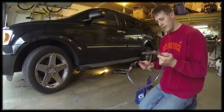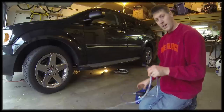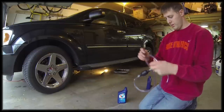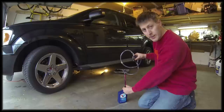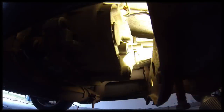To do this fluid transfer, I'm going to use this fluid transfer pump. There should be an arrow indicator showing which way the fluid should flow. We'll have a full can of new ATF fluid, use the fluid pump to actuate it, and it should bring fluid up through the hose — that's how we get the fluid into the transfer case. You're going to need your drip pan underneath the transfer case, because we're going to pump fluid in until it starts running out the top — that's how you know you have enough fluid in. It should take a little more than a quart.